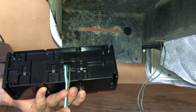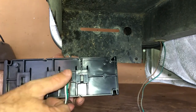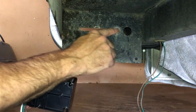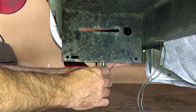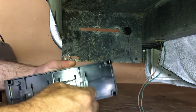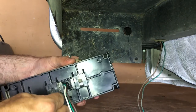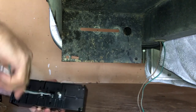If you put this flush up against your trailer, the wires won't get pinched, so use those grooves if you need them. This particular trailer is a Triton and it has this groove cut across for the wires and the bolts to go through. We're gonna put this up here — you just slide your bolts into these grooves, these little channels. Just pick whichever ones fit; the outside ones on my trailer aren't gonna fit, so I've got to use the two inside ones.